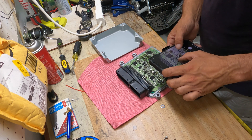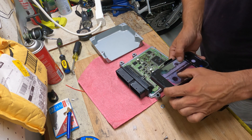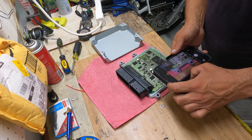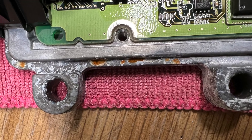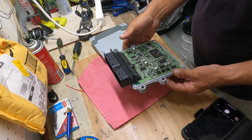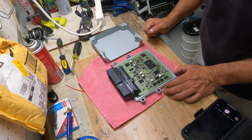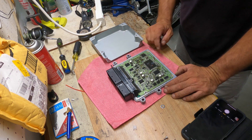I used my phone to magnify every single connector as I went along - that way you can see if any water has penetrated the box without your notice. I found the missing center ground connection, and if you look at the picture I'm showing here, you can see there's a lot of corrosion formed on that part from water that has come in over time. The water appears to have gone more than halfway through the aluminum casing.